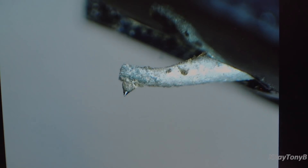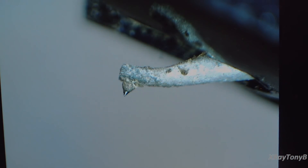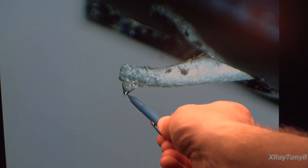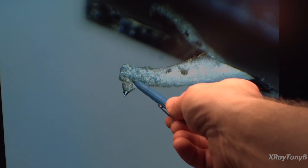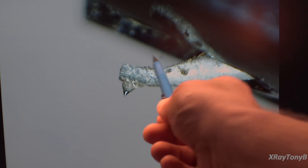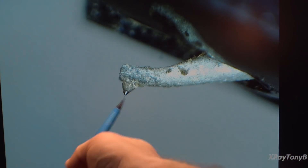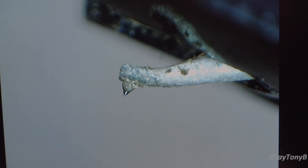You can see this is called a bonded stylus - there's a base plate here, it's hard to see because of all the crud. This is as far as I can magnify with this camera; I would need a different lens to get even closer. But you can see where the actual diamond is bonded onto a little base plate, which is then bonded onto the cantilever. This is a little bit less desirable. A nude diamond would actually have a little hole drilled right through the cantilever and the diamond would be one solid piece that goes clear through. Supposedly those give you a little better performance. An elliptical nude stylus is considered a good type of stylus and it's a good all-around one for good quality sound.